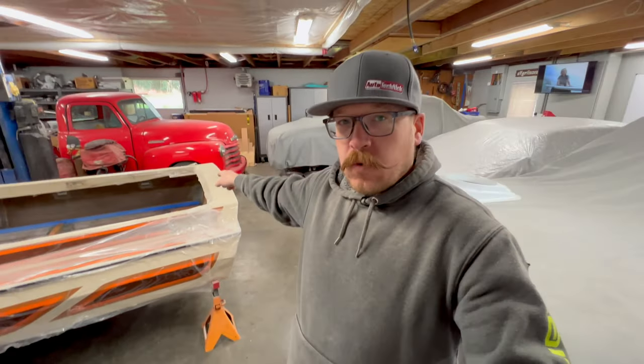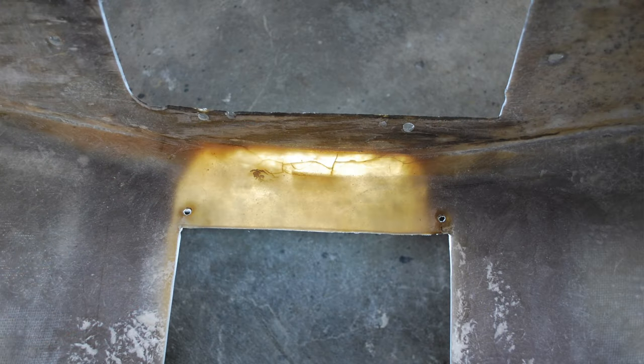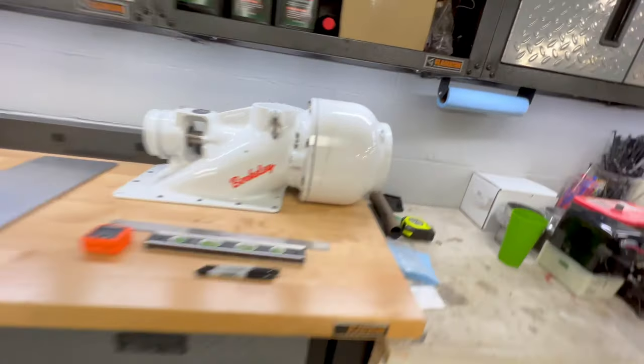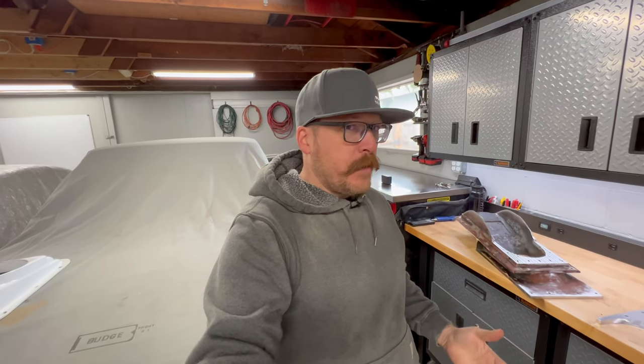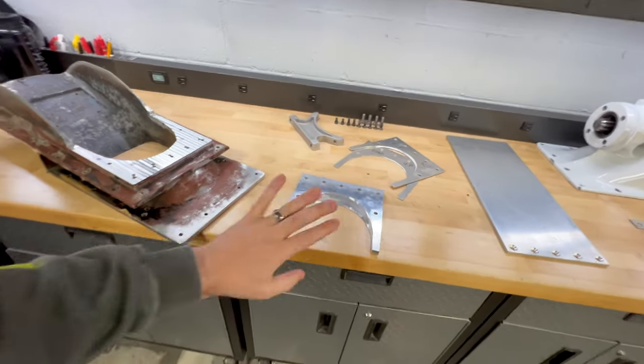The other weird thing I found is back on the keel at the rear of the pump, where you grind away on the bottom for the shoe — that fiberglass was very thin, pretty damaged, and had been worked on, so I had to do a bunch of reinforcing from the top. Also, this boat came with an extra Berkeley pump; it had a dominator pump, and if you look at the back of the bowl it has provisions for a ride plate mount. So I had a lot of clues telling me this thing had a shoe and ride plate, but the way the intake was machined it doesn't look like it had a shoe. Once I found all this I just said: let's make sure it's right, get everything straight the way it needs to be.